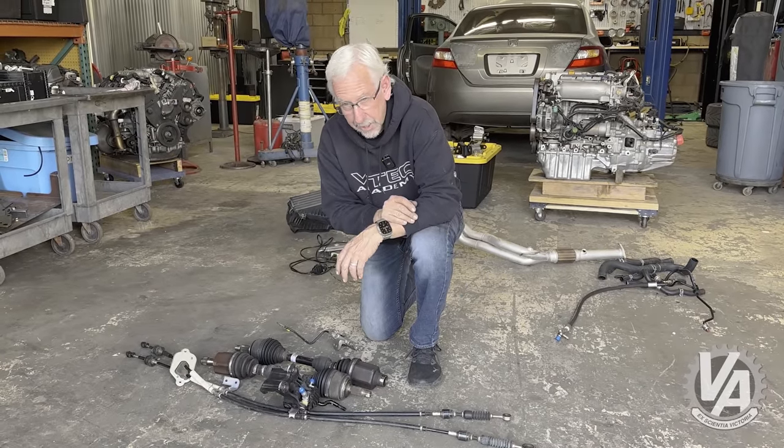Next is the intake. This is a stock intake. One of the things about this engine is it has a MAF sensor, and the MAF sensor calibration is dependent on the size of the opening. So you are going to want to use a stock intake air box, or an aftermarket intake that has a similar setup. If you wind up with a larger intake air tube, that requires recalibration. We actually found this one at a salvage yard — they're not super easy to find. There are a couple of companies that make aftermarket intake air tubes for this vehicle, and they should be sized properly to work with the stock MAF sensor.